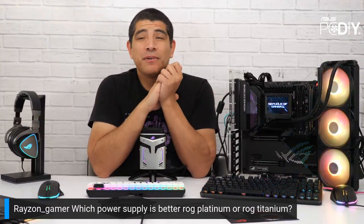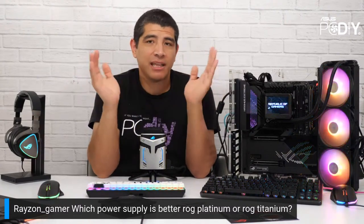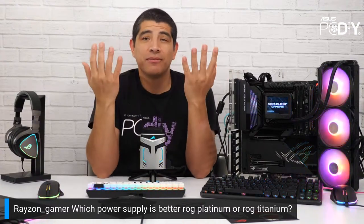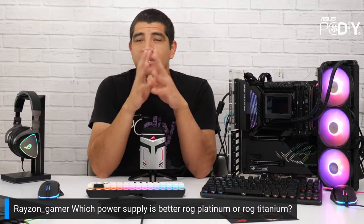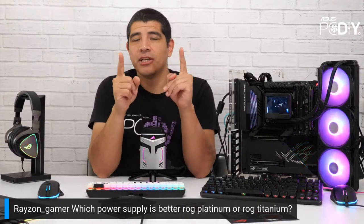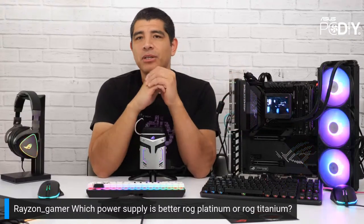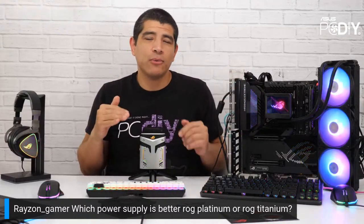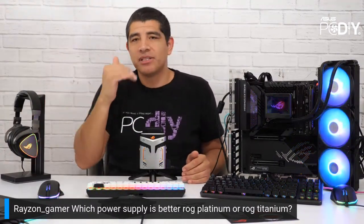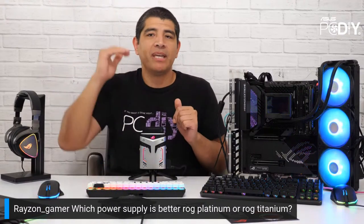But I will say that for almost 90% of users, there's very rare cases where they need to exceed a 1,000 watt power supply. For most enthusiasts, 850 watt to 1,000 watt is more than sufficient. And I would probably say for like 70% of builds, even a 750 watt or a 650 watt is more than enough. But overclocking can, like I said, add a considerable increase in terms of wattage. Especially with higher end components, certain graphics cards and CPUs actually have what's called peak power requirements. That means that while they might not generally use that at load, they can ask for an extremely high peak amount of power. And in some scenarios, having that headroom to account for that peak power request is important in terms of giving you the best experience and stability.